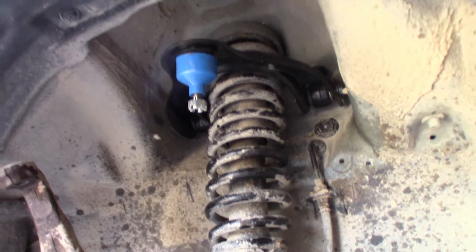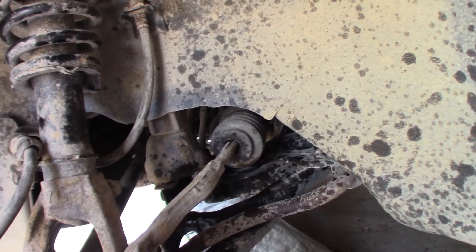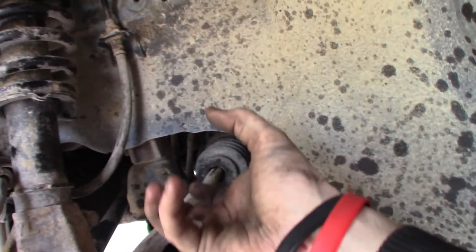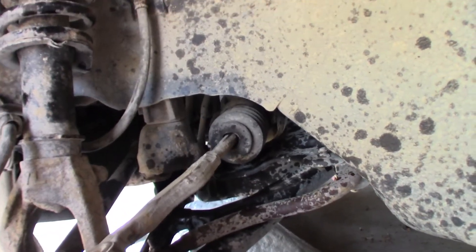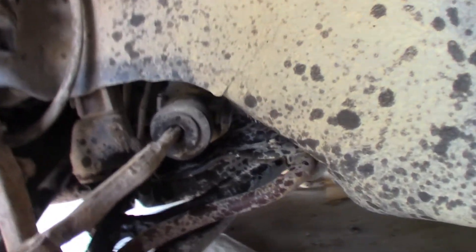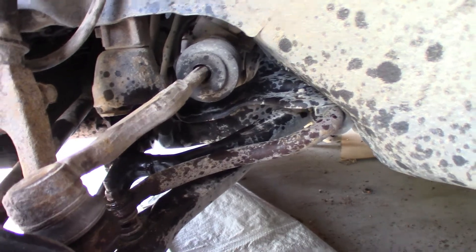As you can see, I got the upper control arm done. I got that done. Next process is the outer tie rod right here, and then the inner tie rod there. If you're going to do this, you need a special tool because it's like a special sort of socket that you need to pop it off for the inner tie rod. I have that tool because I've done this before, so I'm going to go ahead and take care of business.